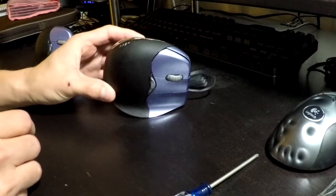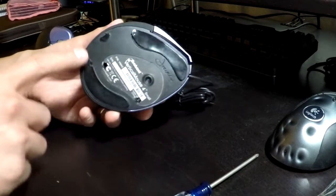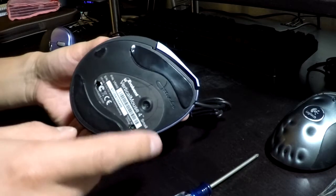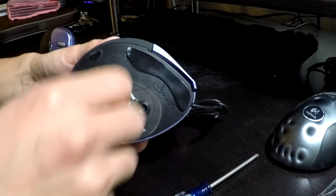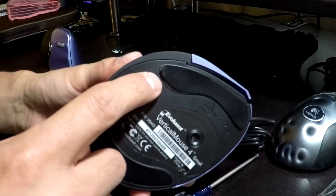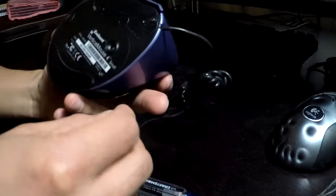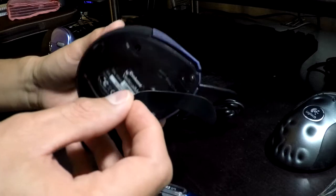The first thing you'll notice is there are no screws on the top. On the bottom there are some hidden screws. You don't have to remove the two side feet, but you will have to remove the top plastic foot. Use a hair dryer to heat it up so the adhesive gets warm and doesn't stick as much. There are little tabs next to it that you can use to peel it off. Be careful peeling it off — if you wrinkle or bend it, it'll catch on any surface.